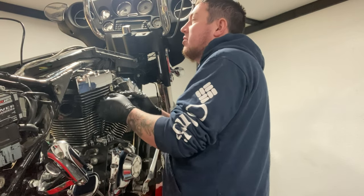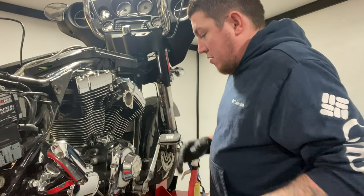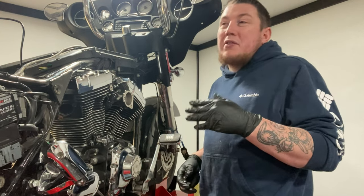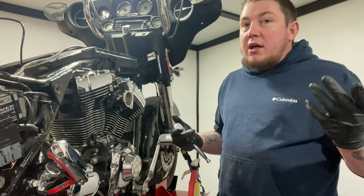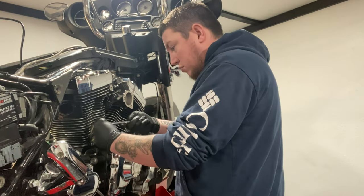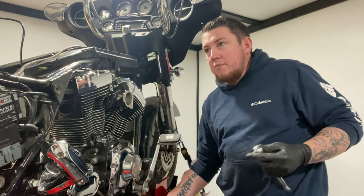Harley's Screaming Eagle lifters, it could have just been a fluke, but we had a set go bad in like 500 miles. I know people are going to be all loyal to one company when talking about lifters. Well, I think there's only like 4 major companies that make the actual tappet blanks, but don't quote me on that. After that, it's just whose sticker do you want to see in the box. It's not made in house by them.